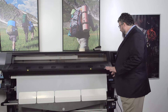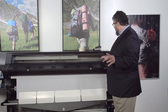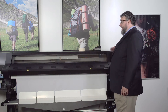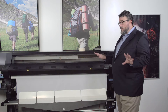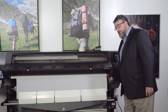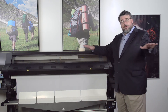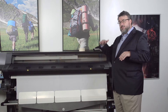The first thing I do is lift this lever, which releases the pinch rollers. If you look in the print path, you can see it is bunched up on this corner. If the print head were to come out right now, it would clearly catch the roll on this edge. So you don't want any carriage movement with the print head coming out yet. I lift the tension right here, and that immediately straightens everything out — everything goes completely flat because there's no tension pushing it down and causing the edges to bunch up and pop.